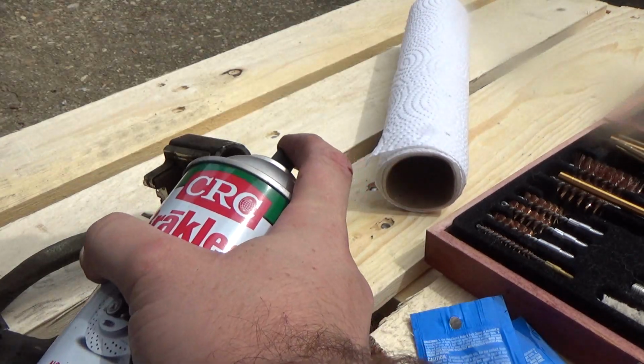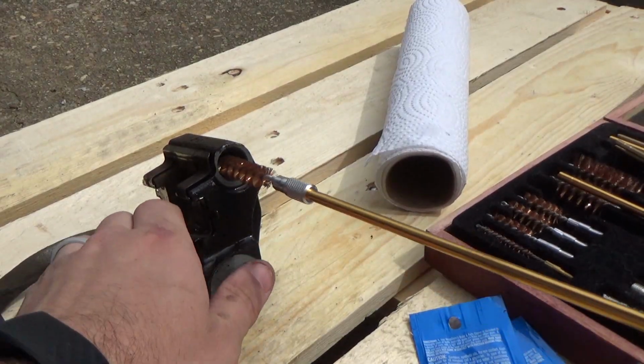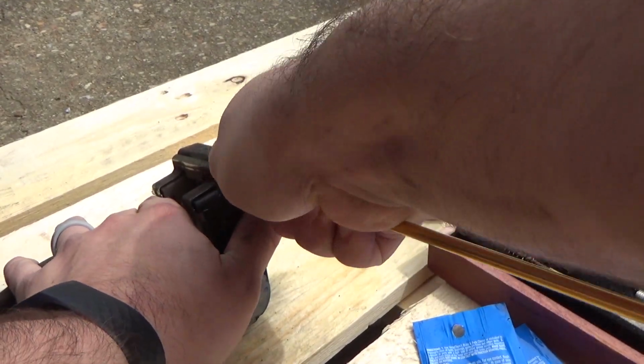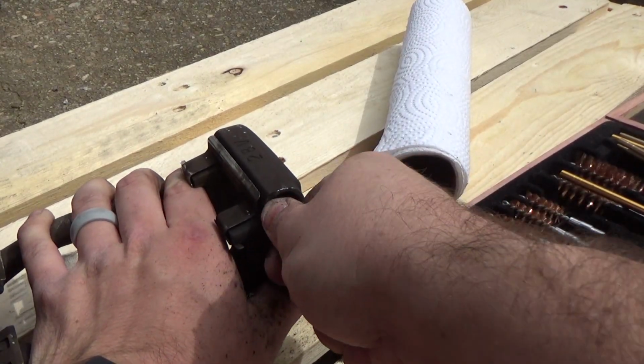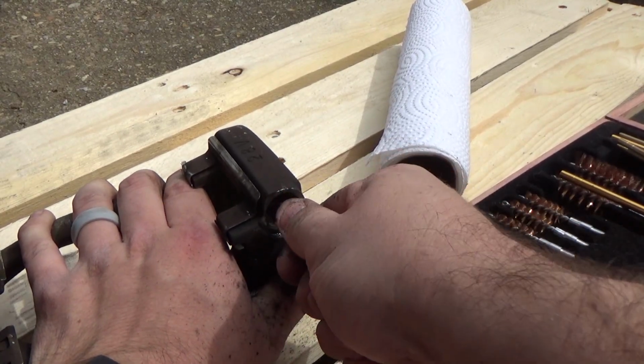When the guide pin does finally come out, we will need to clean the guide pin hole before installing the new pin. I found that a 9mm brush from a gun cleaning kit fits the hole perfectly. I forgot to film the installation of the new pin in the old caliper bracket, but I'll put in a clip of me installing a new pin in the new caliper bracket for the passenger side of the vehicle.